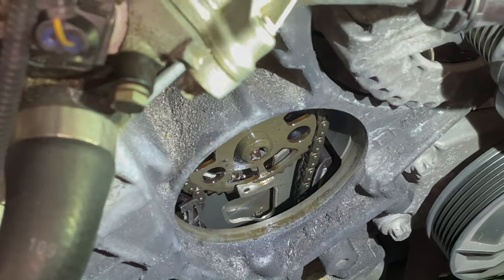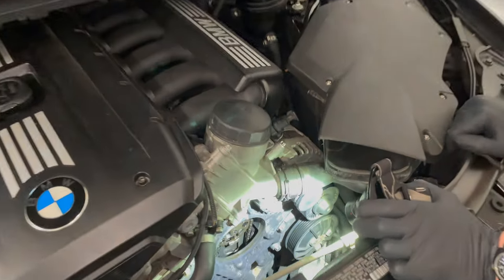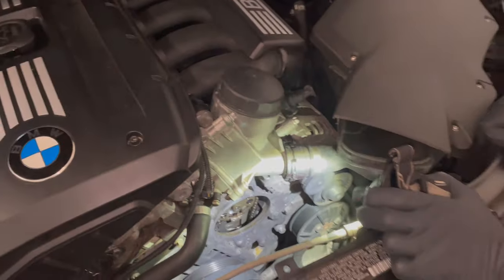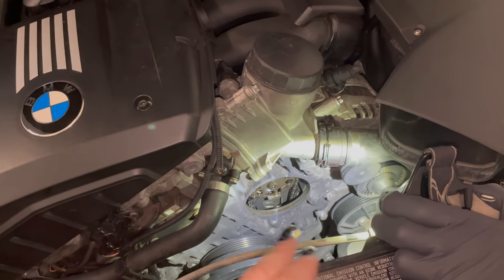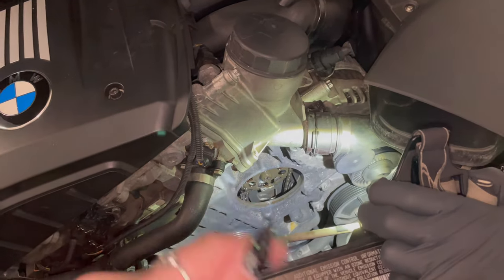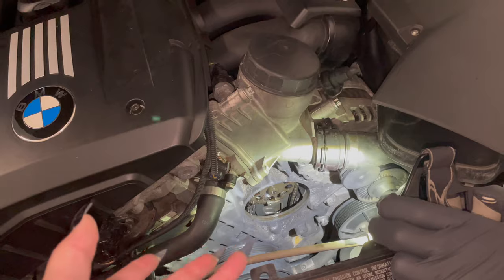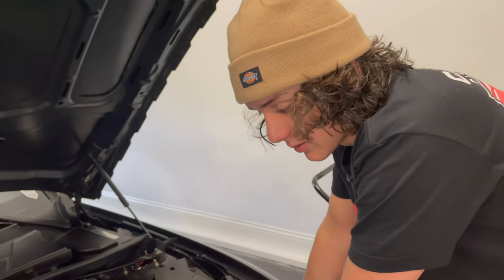This is an extreme rare case. I've talked to several people — CC's talked to several people who have been working on BMWs for 10, 15, 20 years and no one's ever seen this before on an N51. It's like typical N20 timing chain guides — that's typical to see — but I've never seen the oil pump and vacuum pump chain guides break. This chain down here isn't like my timing chain, so this doesn't affect the timing of the engine. We also aren't 100% sure if this were to fail completely, if my oil pump would have not been getting any pressure — we still won't know if that would have been the case. But either way, you don't want that down in the engine. This could have been disastrous if the vacuum pump wasn't driven by this.